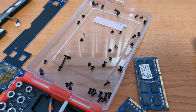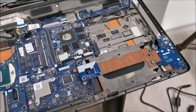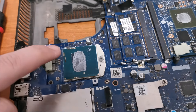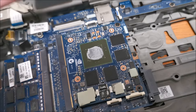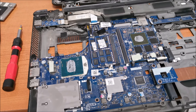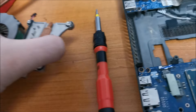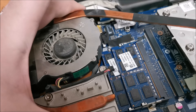There are way too many screws on this laptop to show on video which goes where — it's borderline insane. Put this board and this board in place — still the same type of screw, M2.5 times 4. Next I want to put this, but I'm not going to be changing the thermal paste because we don't know if this actually works anymore. What was in here could have killed this — corrosion there and the short in here. But if it works, it's simple for me to come back and change the paste. If it doesn't, well, nothing changes. What you need to make sure is to put these cables in the proper location, otherwise this will not fully lower in place.